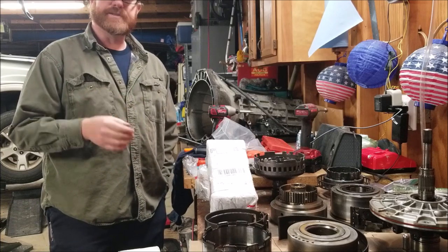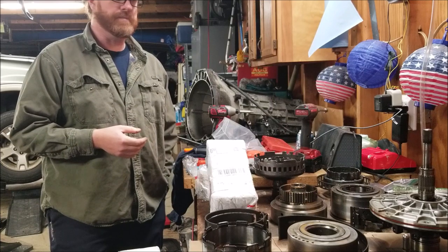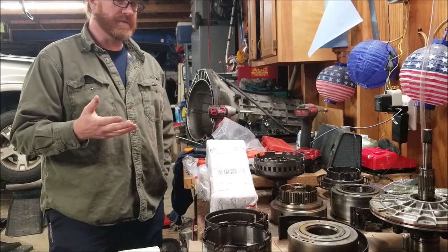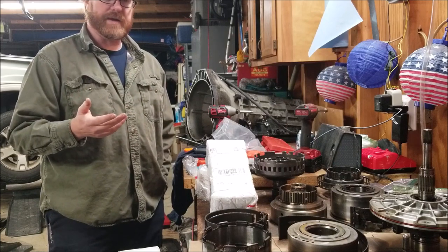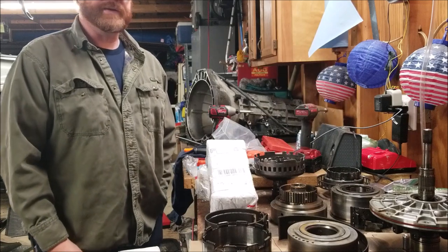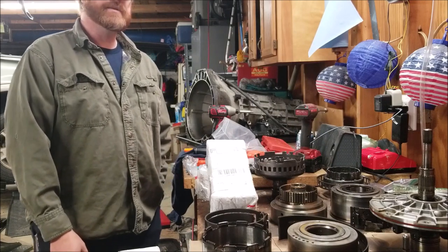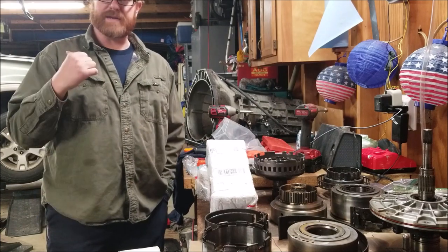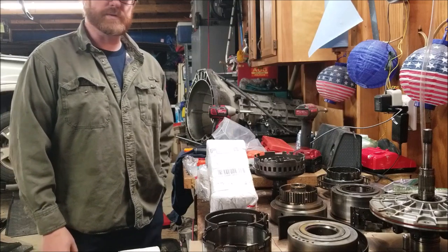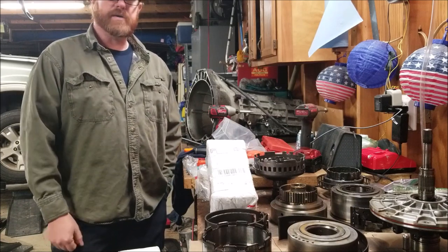I'm sorry I didn't make a video of the removal and installation, but I have a lot going on — it's about a week before Christmas. I did want to make this video so you know what you're getting into if you decide to attempt this yourself. I have a lot of tools and didn't buy anything special. You'll need a swivel socket set, standard and metric, nothing bigger than 18-19mm, basic hand tools, and that transmission jack — that was basically the one thing I didn't have. Living in Ohio, road salt corrodes everything, but it wasn't too bad.